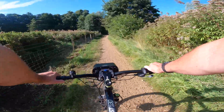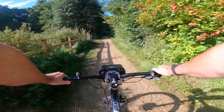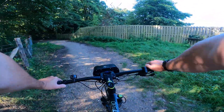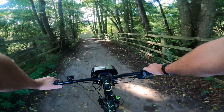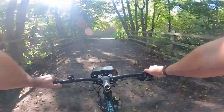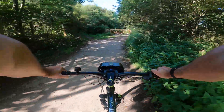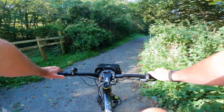The motor's got so much torque - this is a geared 250-watt motor and it's road legal. It's got a maximum speed of 15 and a half miles per hour and everything else to make it road legal in the UK. It's got a lot of torque and having a light bike helps. The problem with a lot of Chinese electric bikes for sale is they're actually quite heavy and built up - which makes them strong, but it means that on a 250-watt hub drive you might find the performance isn't particularly great.